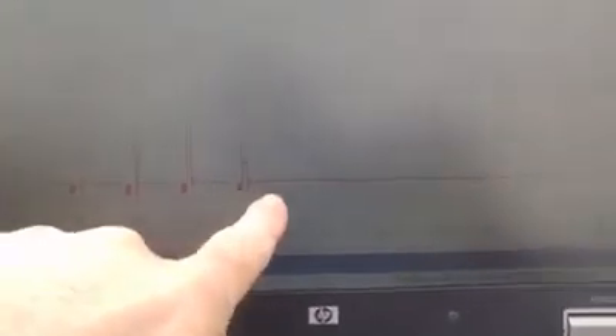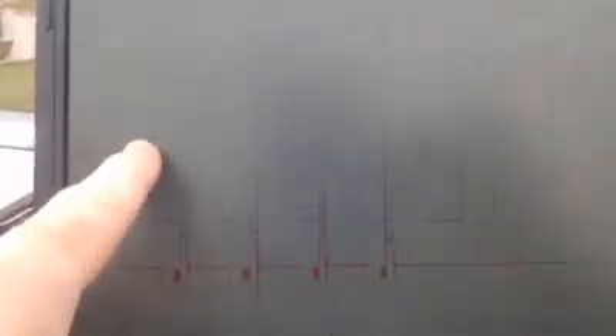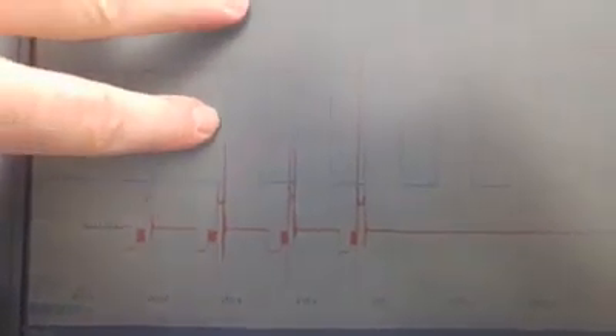The coil is firing and then all of a sudden the coil doesn't fire right here. Looking up, we see the blue notches lining up with the green spout. Here's where it stalls — and look, the blue notches are still there, the spout line is still there, and they continue until finally the motor turns over so slow that there's no more signal.